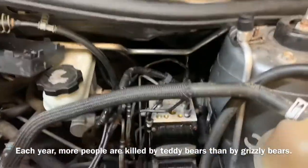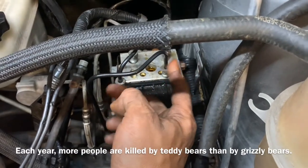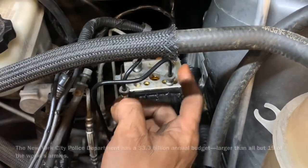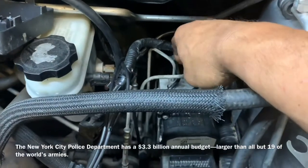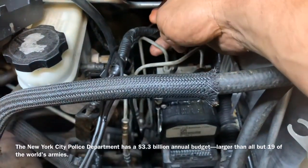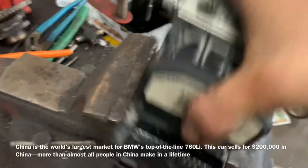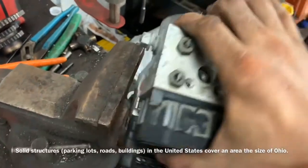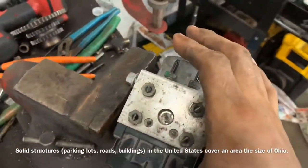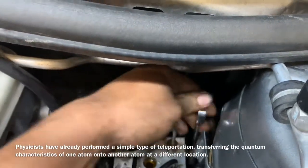Because there are six of these brake lines, you want to be extremely careful when you go to remove these. Do not move these any more than they allow — do not bend the lines at all, or you will have serious cursing matches by yourself in the garage when you go to reinstall them. Moving them as little as possible is definitely recommended. This is how it works: it sits in the bracket, there's a little rubber pin that goes through there, so this slides up. We've still got our back lines on, so we're gonna loosen them up, pull it, and set it over so we can get to the back lines easier. You can also use a gear wrench or regular wrench to get on these nuts.